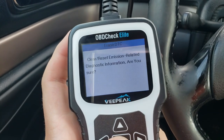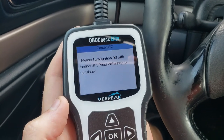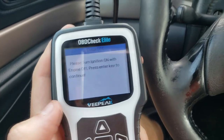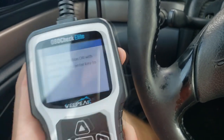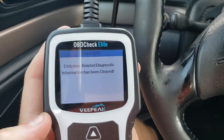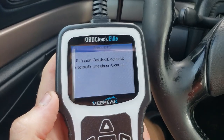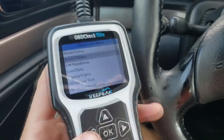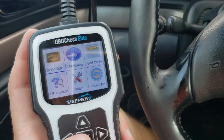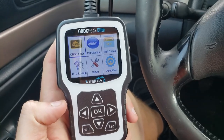We're just gonna race it for now, see if it wants to have this issue again. I think it's tripping O2 warnings because it's misfiring and because I'm not using an actual VAGCOM or VCDS scanner. It's just kind of generic reading. I think we're just running into a cylinder misfire. I'll have to hit up my buddy that has a VAGCOM, see if I can come scan it today.